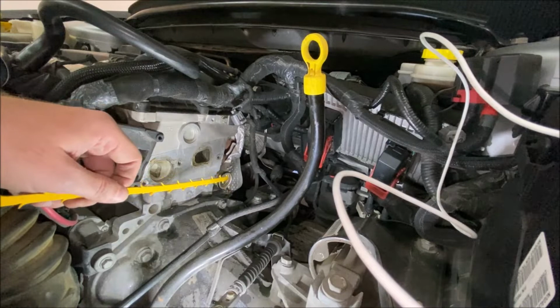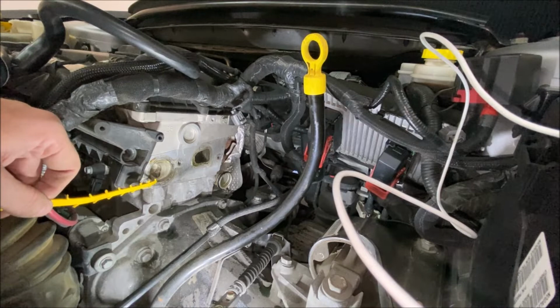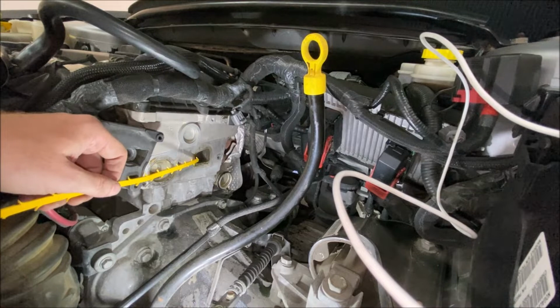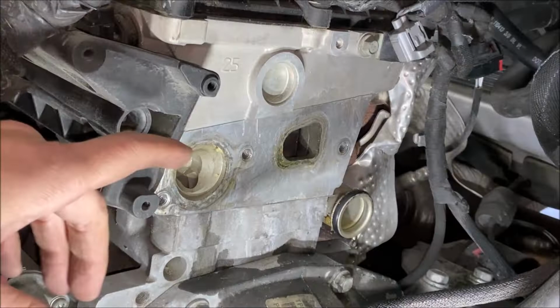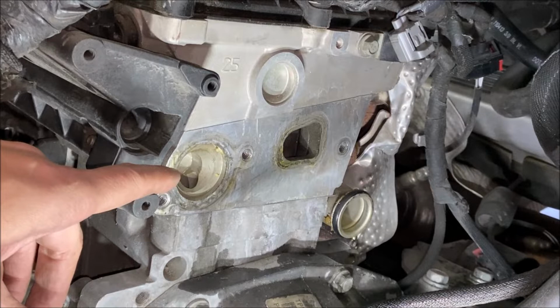This is where that second thermostat mounts, and this is a mounting surface, obviously, and this is also a gasket on the housing. Goes against this surface, so before we install a new housing, we want to make sure we clean the engine block off in these two locations and then also replace this O-ring. Keep in mind that this is an aluminum block, so you do not want to make scratches or gouges into it, or you're going to have sealing problems with your new gaskets.